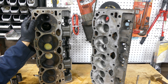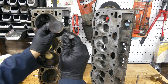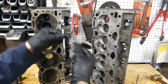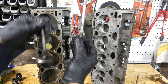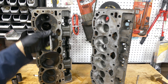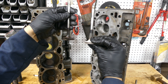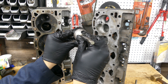This one has a 2.160 valve package. You can see the valve size difference here - put this one next to the other and you can see the larger valve overlapping it a little bit. These valves are undercut, and you can see that this valve goes straight up off the valve face into the stem. This valve stem is actually back-cut into the face - that's a nice little setup. Same thing with the exhaust valve: this one is back-cut and this one isn't, and you can see the size difference between the two valves.